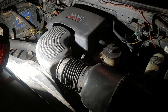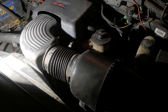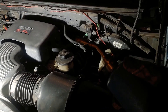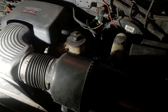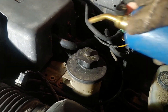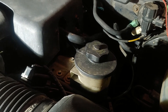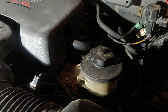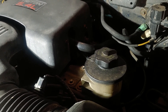A couple of methods you can use to find vacuum leaks — it's really not all that complicated. One that I really like is to take a propane torch, these old ones work really good, turn the gas on but don't light it. With the engine running, go around all the hoses and connections, and if the motor revs up, that's where your vacuum leak is because it's sucking propane instead of air. It's almost sort of kind of like putting nitrous.